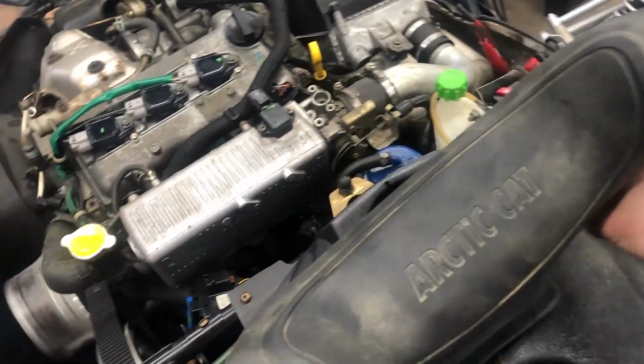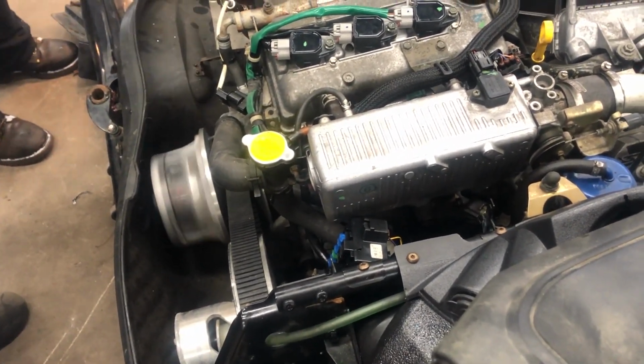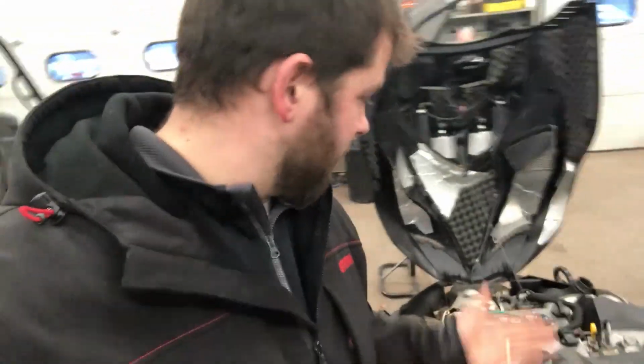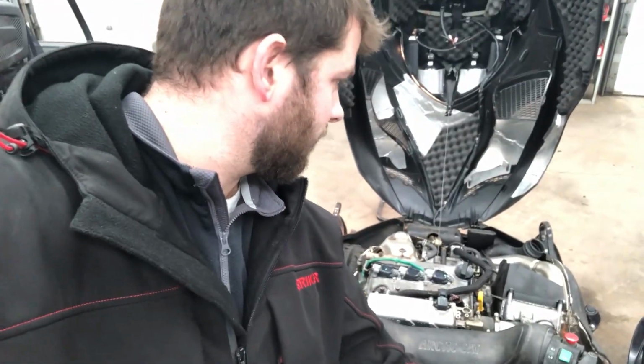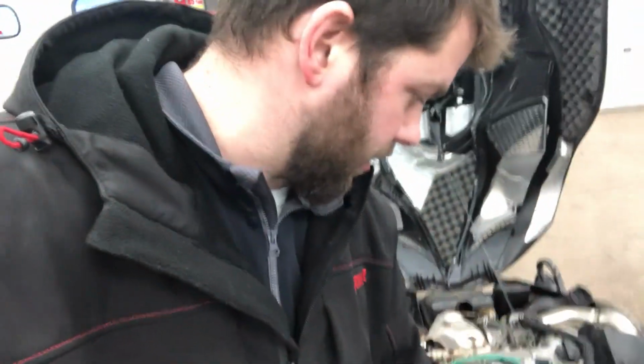Awesome, awesome, awesome. Should we see if we can get a second start out of her? Now you're pushing. Alrighty guys, well, just like that, basically dried her all up and changed the oil, dropped the chain case through it. It was all full of water. Unreal. And now the next part is we did spray all the connections off, put dielectric grease on them, this good stuff. But the seats are gonna be the next part.